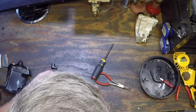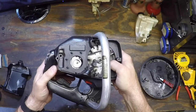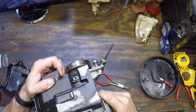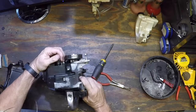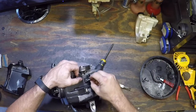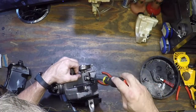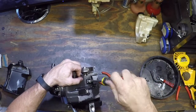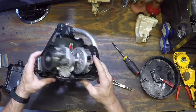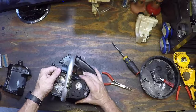Double check to see if the holes align. Now we can get all the holes to align and get them pretty close — once on the top or on the bottom. Sometimes it takes a little massaging to get them into place. Let's get one started. We'll start with the screwdriver first, not the impact, because we'll end up stripping them. Especially on this one — if you get it in, you cross thread it, you strip it, it's gonna be a job to get it out.